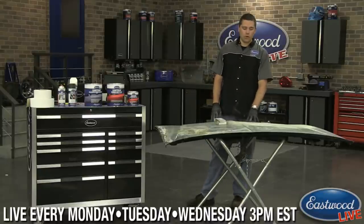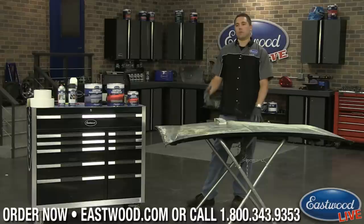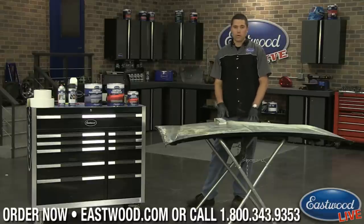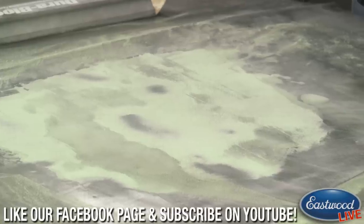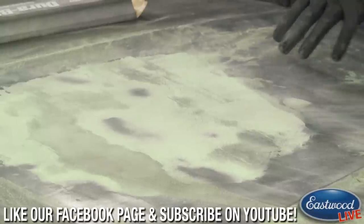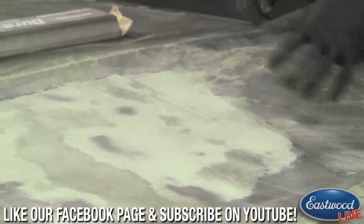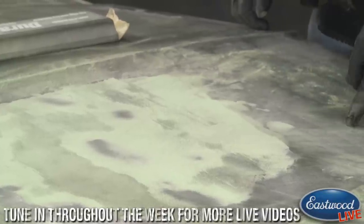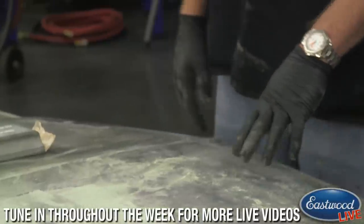You could do 120. Much more than that, you're relying on the heavier body fillers to grip such a small sand scratch. So 80 grit's perfect. And then we'll also jump that question to bare metal. It could go one of two ways. If you were going over bare metal, same thing. A lot of times when I have a repair and I take it to bare metal, I'll just take my DA sander with 80 grit and buzz the whole surface. So that 80 grit sand scratch in the metal is also acceptable for the body filler to adhere to.